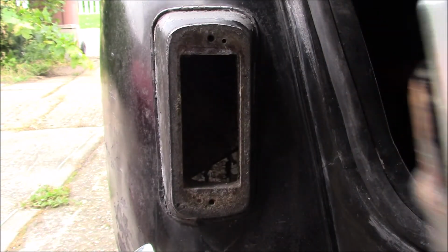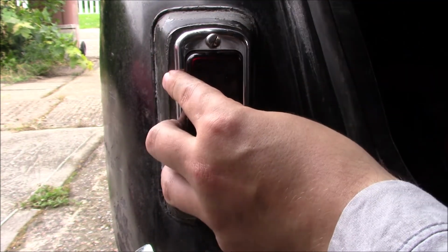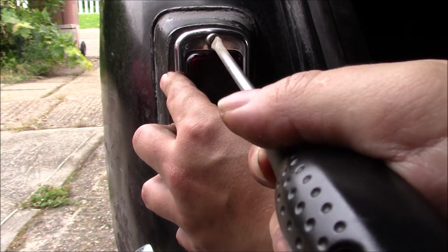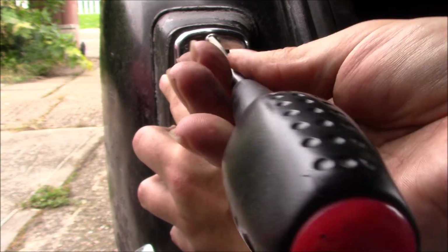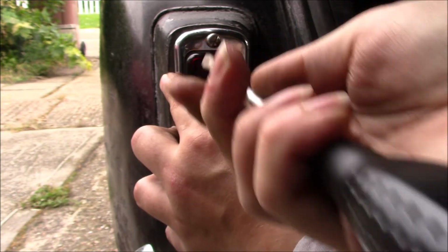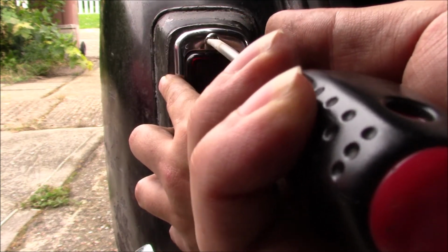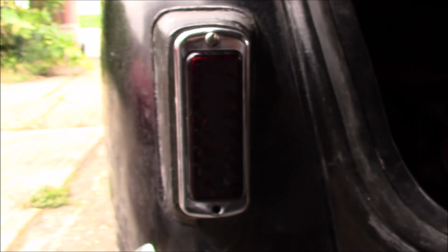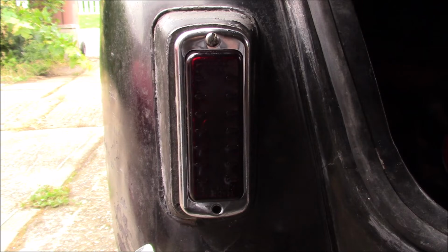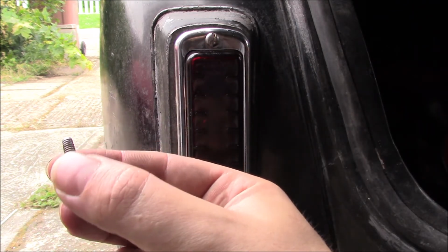And one thing to be aware of is when you're going into an aluminium housing, you need to be careful you don't cross thread. So when you push the screw in, unscrew it, and you'll hear a clonk as it actually aligns with the thread. Like that. Then you know the thread's seated, then very carefully and slowly screw it in until you feel it just engaging with the thread. That way you shouldn't ever cross thread an aluminium thread, which is just a nightmare when it happens. Also, these have a little sort of round end on them just to help you locate them in the hole.